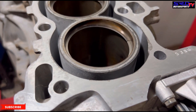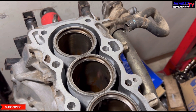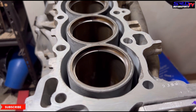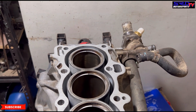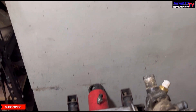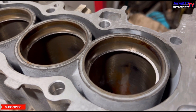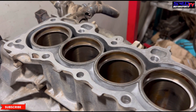At this angle, that's where the piston rings are — or the top ring when it's at top dead. So we check on that. And then here, we check the lateral side, the one across. It's going to give us a vague idea if the bore is actually oval or not. But this one I'm not worried about because we can actually see the crosshatch. This one is lower than top dead center — about one inch below the bore — and we're still going to check the gap there to make sure it's consistent. And it is. So that's how you check it.